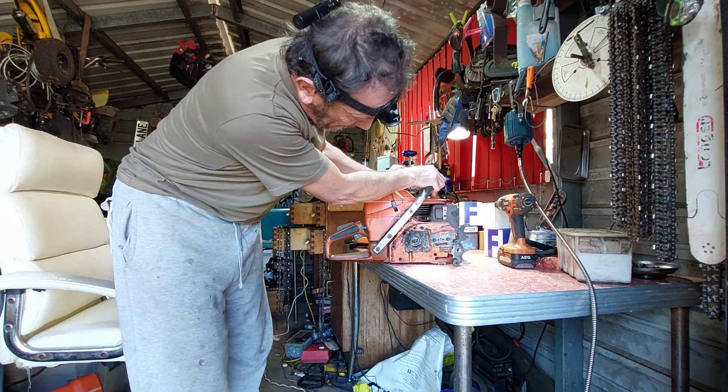I'll pull this off, the filter lid screws. Might as well, if you have an impact driver for that. I did. Okay, but on this spare saw, all the holes for the pull start, there's one good screw. The rest are all really big, out of spec, out of whack. I don't know if I can tap them because it's so out of whack that when the cable comes in, it goes back in around it. Yeah, it's just worn out. Totally worn out. I bought a new spring for this, it's been re-sprung, but it's no good at all. But I didn't expect this one to break. I really did not.